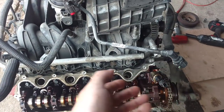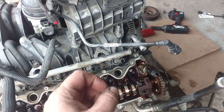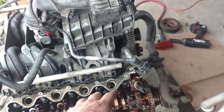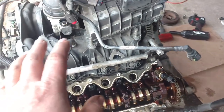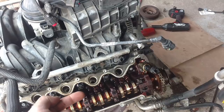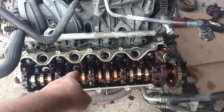Here's what I'm left with — you see what the engine looks like. This buildup is broken-down oil, because of lack of maintenance, lack of oil changes. And it's frustrating, because for what an oil change costs — this motor takes seven quarts of oil, and from the factory they use 5W-20 synthetic. I use 5W-30 synthetic, and that's always worked very well. I've seen a lot of Ford people say once you get enough miles on these, go to 5W-30 synthetic — it's better on the cam phasers, better on the solenoids, and they'll last longer. Seven quarts of synthetic oil and an oil filter — what are we talking, $35? So, either spend $35 or it'll look like this.